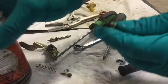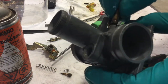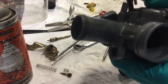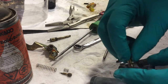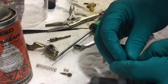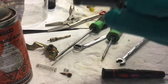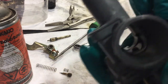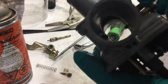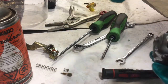Give it a squirt of lube. Got to be careful with penetrating oil, because some of it might make those O-rings swell ever so slightly, and then they get really hard to try and get started in there. Once I get it started, there we go. Now when I turn that in, that's just going to hold the throttle up. The more you turn that in, it just lets a little more air in, and that'll adjust your idle. I think it was about five turns in or something, which is surprising.